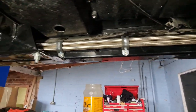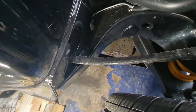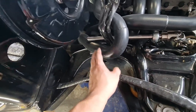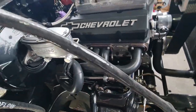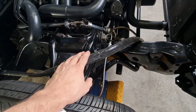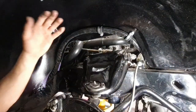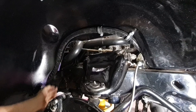We've got those lines nicely cushion-clamped up. The power steering lines are running out from underneath the corner of the cab here. We've got them in a heat sleeve, partly because it's going to run around the inner guard close to this exhaust here, then it's going to run around the inside of the inner guard and over into the engine bay. Partly for heat, and also because it's going to be on the outside of the inner guard — we want to give it a little bit of protection from stones and that kind of stuff. We've got the inner guard on and the driver's side guard on, as you can see.